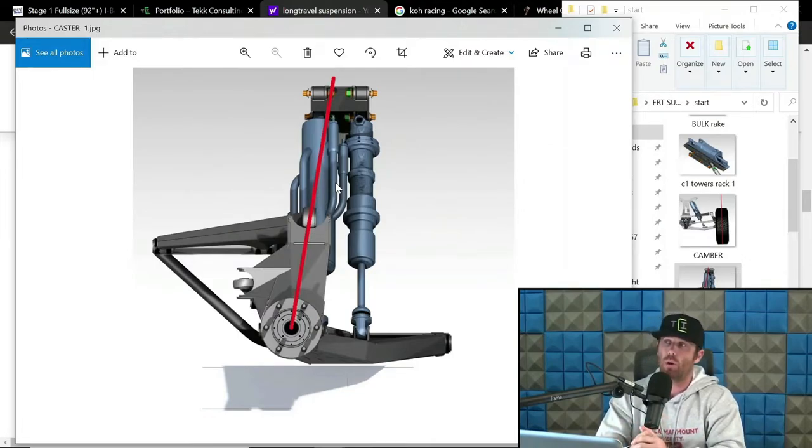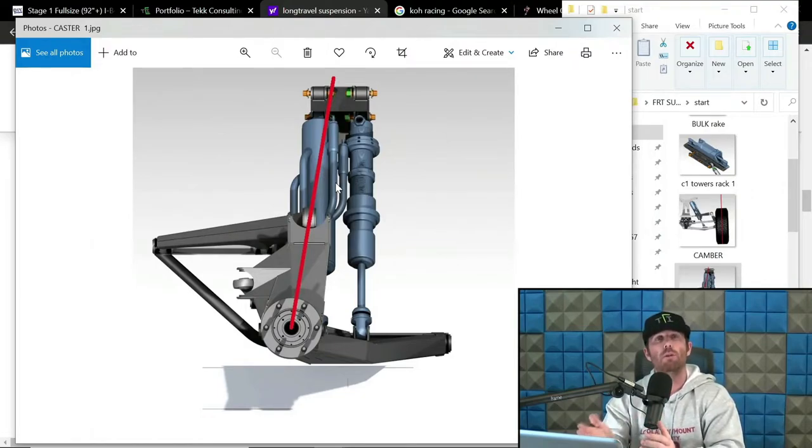We have had situations where an individual had a truck that was at 10 degrees and they had us redesign uprights and upper arms to bring them down to 8 degrees. And I have also done the inverse, going from 8 degrees to 10, 10 to 12, etc. And in between, I've had guys do 9, I've had guys do 11. So again, it's different strokes for different folks, but I would say that's a good range that competitive trucks are going to be in.